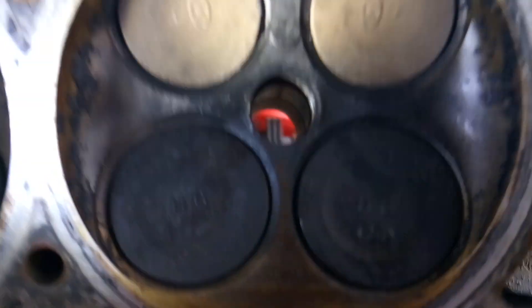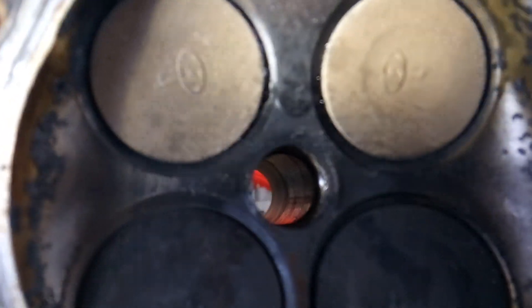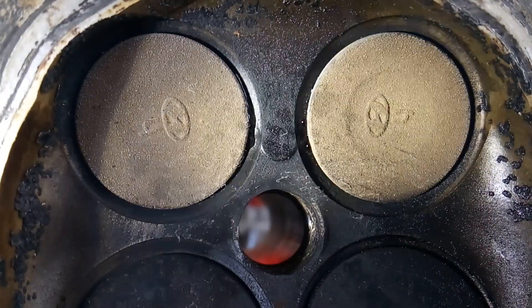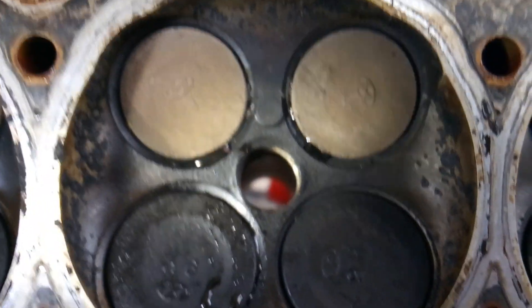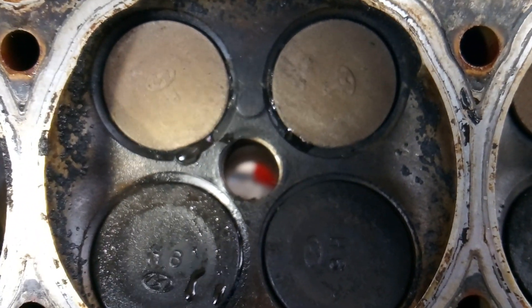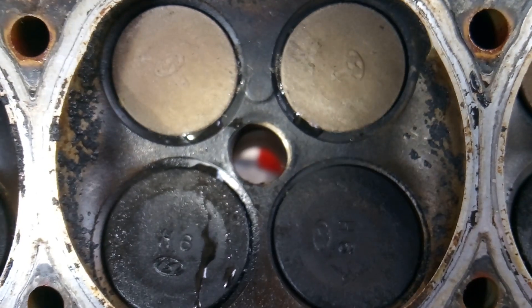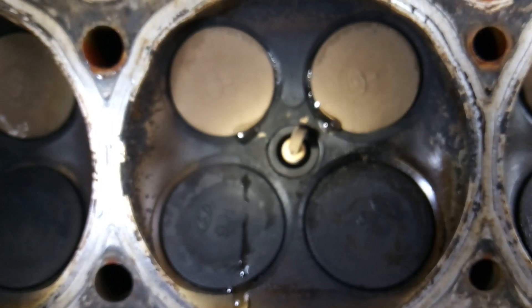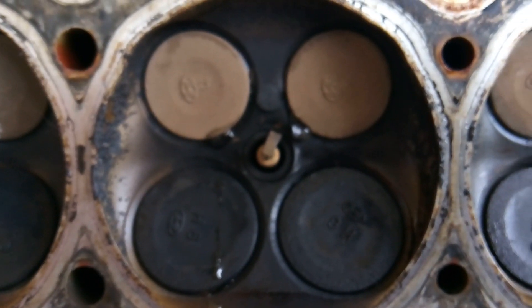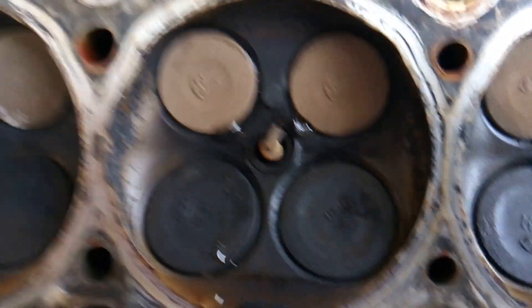One has a little water starting to come through it. These are just leaking. These are not. These intake valves are nowhere near shut, and that's where you can lose compression — this can cause a slight misfire.